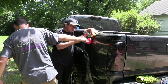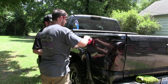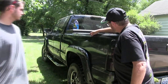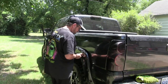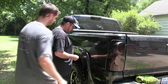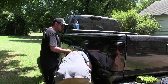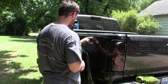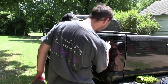Before any haters get on here — like I said, we are not trying to get this perfect. I know PDR could get this perfect; you could use some pull tabs and PDR tools to finish it out, but we're not wanting to spend that much time on this. This is just a quick fix to make it look better. You can still see a little bit of a high right there and a little bit of a low, and there are some other dents in the panel. But we did get it where this flare fits better — it will not have that gap when we push it up and tighten it back up. That was the main point of this, and it looks a heck of a lot better than it did. Just a quick fix — 5 to 10 minutes to make it look better from 40 feet away. We could use glue tabs to really make it look better, but maybe later when we have more time.